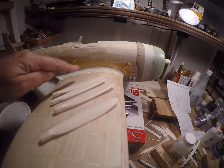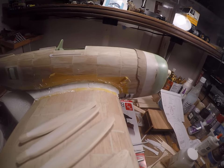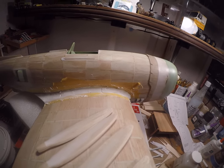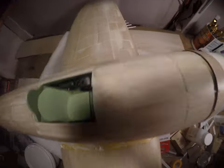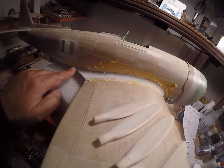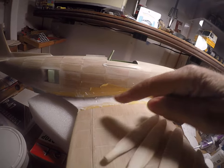You can see the wing root fillets are going in. This is literally the second application — I had put just a shallow bead along the wing root seam just to seal it. Now this is the first of probably two, three, maybe even four applications of filler. Got it done on both sides. So you see how the fillets are necessary in order to complete the shape and get to the proper profile of our wing root fairing.